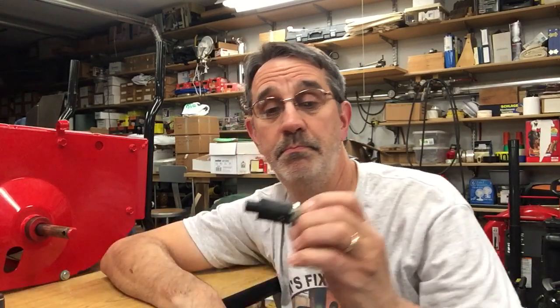He went out there next time he wanted to mow, and he looked, and he's got all this oil running out from in front of the mower deck going down the floor drain. So he said, what's the problem? If he would have been parked over the floor drain and not seen that oil, he would have driven out of his garage, mowed his yard, and blown up his engine. These things are the biggest issue Briggs & Stratton engines have, outside of not torquing down the 2 bolts on the cap for the connecting rod. Another big problem. Throw them away.